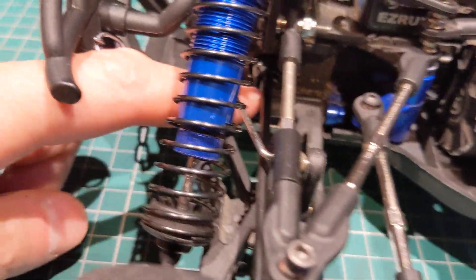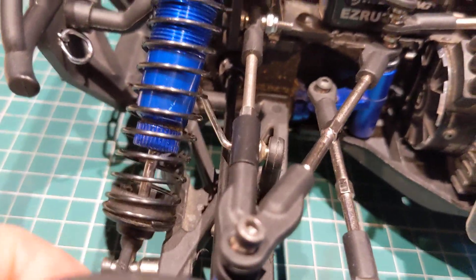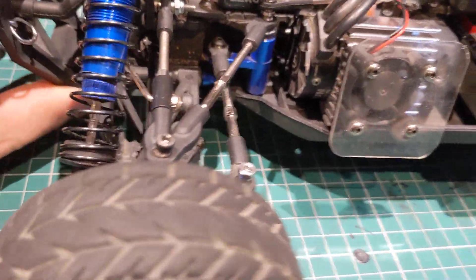See in here - the lower control arm pivots. What I've done is angled them down at the front, which stops the car rising when you accelerate.